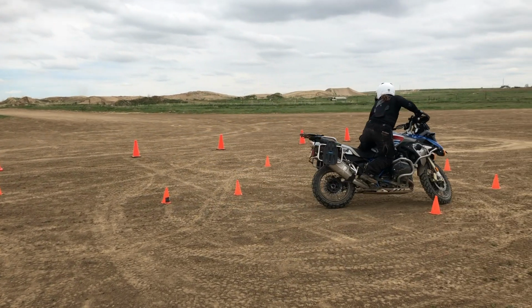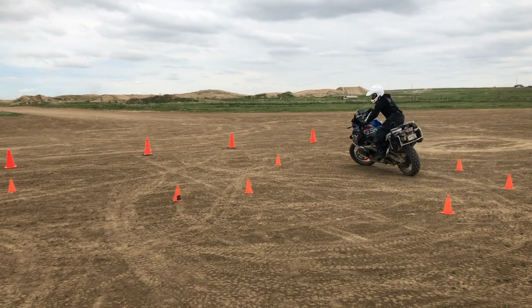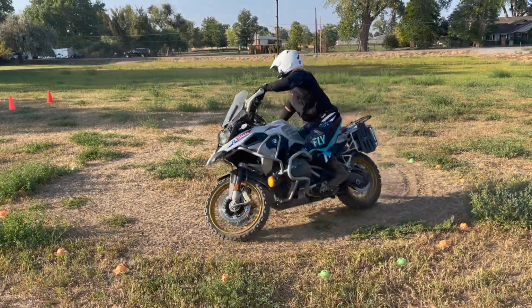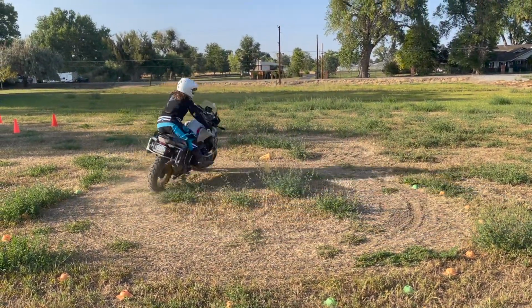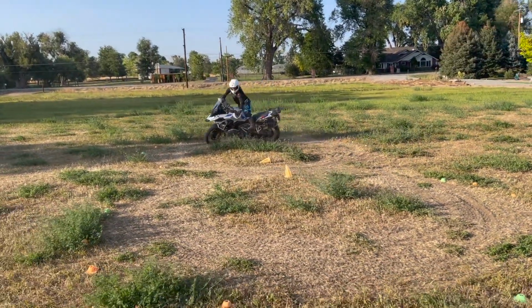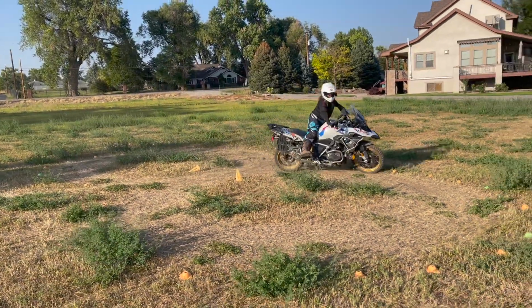As a short rider on a Boxer GS, I get good leverage on the outside of the bike by placing my knee into the top rear corner of the cylinder head. It's another contact point for me to control the bike. And as an added bonus, it's easier on my knees. Otherwise, if you're taller, you may want to consider pushing your outside knee into the tank to help lean it in.